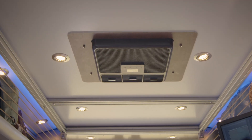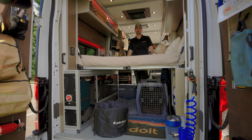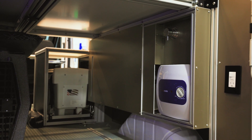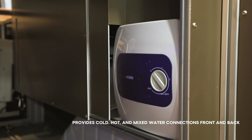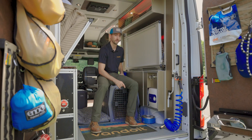Also on the ceiling you have the Max Air Deluxe fan up top, which creates a lot of extra ventilation when you open the windows. Paired with that we have the Dometic RTX 2000 DC-operated air conditioner, which really cuts the humidity on those hot summer days. On the passenger side we have our modular water box with 22 gallons of fresh water storage and a 1.5-gallon hot water tank with a mixer that controls your front and rear quick disconnects.